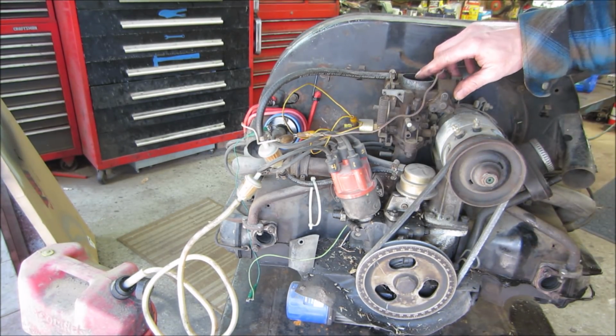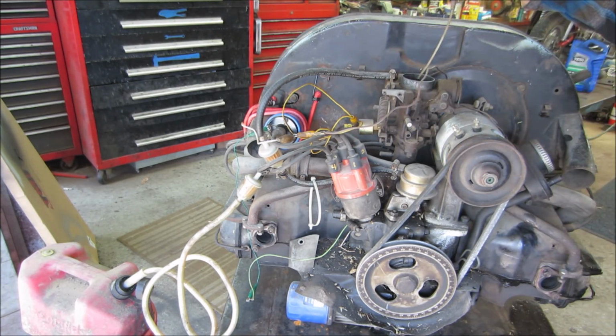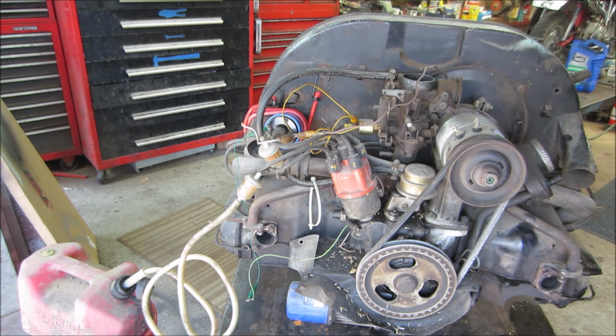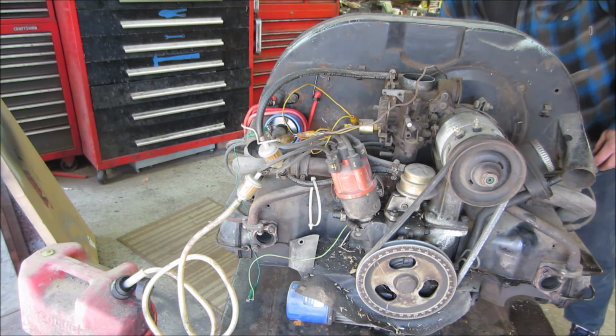This horn right up inside here, can you see? Yeah. That horn right up inside there leads right into the float bowl. So if I stick this bottle down there and shoot some fuel in it, it's filling the float bowl up, so it'll run off of that. And then just give it a little primer. Should fire right back up again once we put power to the coil.